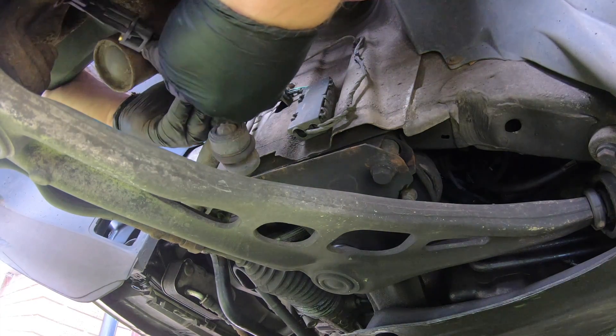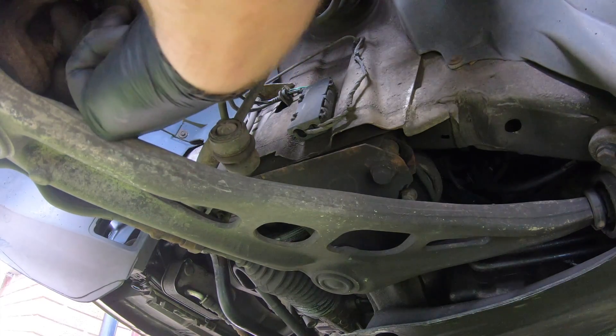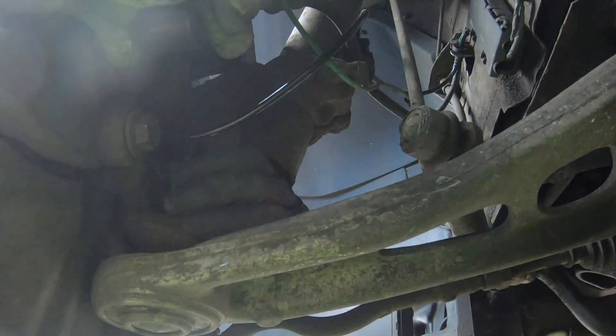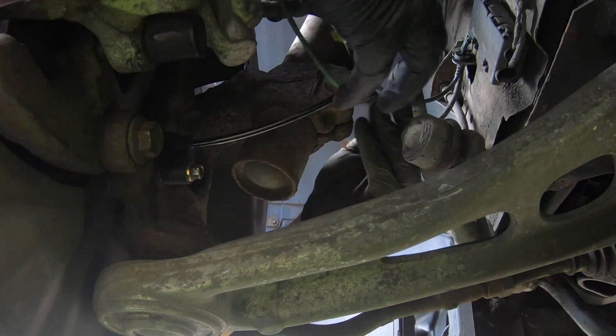Then you need to route these wires and the ABS sensor just goes into place here - it might be a bit stiff. As you'll see I've located the sensor, I'm just trying to locate the hole to bolt it back up. We've got that right here, now we're just going to turn it into place and tighten it up. As you'll see I'm using a 9mm spanner - that's the way you bolt it all in.